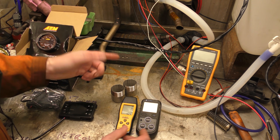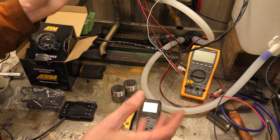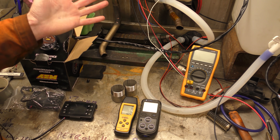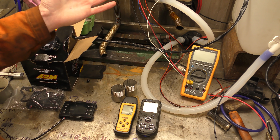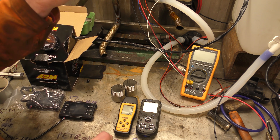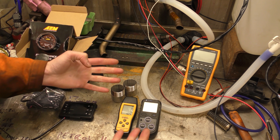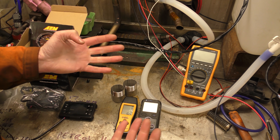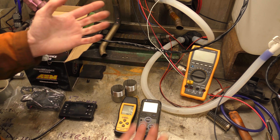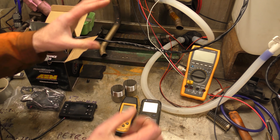Now it's up to you what you tune your heater for. If you want it to last a really long time, make sure there's no carbon monoxide so it's running soot-less. Turn the fan speed down so the motor's not working as hard. Or you might want as much power out of this thing as possible - turn the motor up to 5,000. There'll be a point where adding more fuel doesn't equal adding more heat, but generally the more fuel you can pump into this thing, the more heat you will get out of it until it overheats.